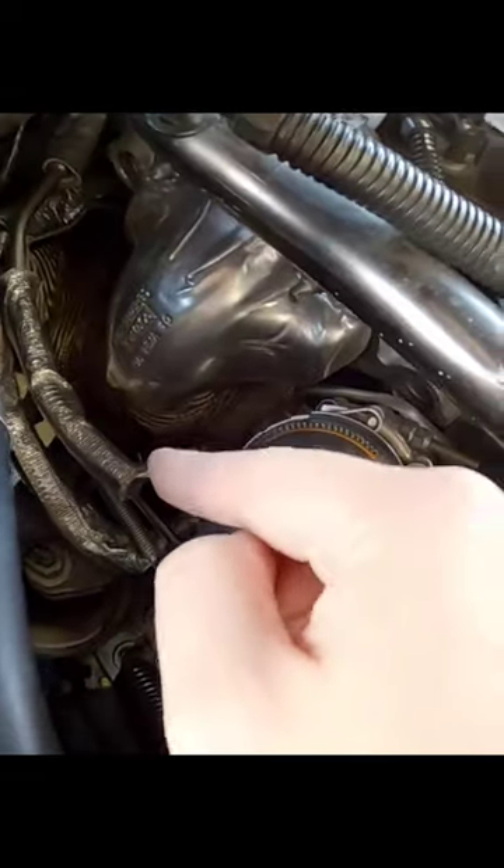Adding the resistance of the spring has done something very interesting. We're at max boost 22.7 psi, whereas before we weren't at this point — this is over 22 psi the whole way. There is an additional 400 RPMs more of max boost just by applying additional resistance against that wastegate door.